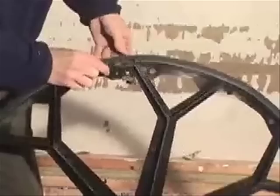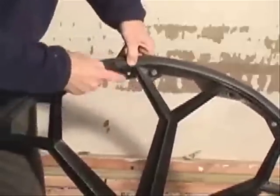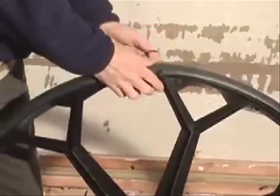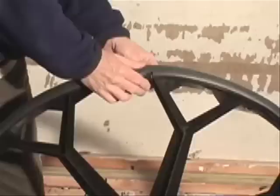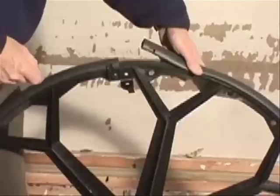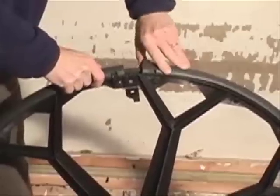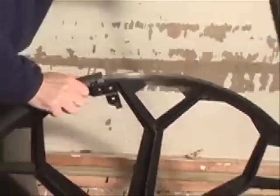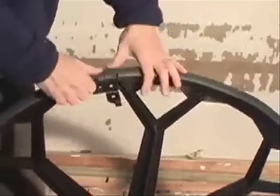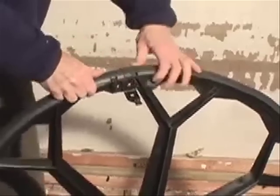Then press the ends of the tire down so they are fully seated. If you have stretched the tire too much, peel off maybe one half or less of the installed tire and stretch it less when you reinstall it, so that the ends are touching when fully installed. You can also try peeling off a bit, then secure the end and work away from the attached end pressing the tire onto the wheel until the extra tire slack is taken up. Now fold the last two plastic tabs into place to lock into the two notches in the ends of the tire and install the last two bolts and nuts with a socket, pliers, or wrench. If the tire is short, you have not stretched it enough — peel off one quarter or more of the installed tire and reinstall it, stretching it a bit more until the ends meet tightly. The tire is very stretchy and tough, so it is difficult to damage by stretching it. Just make sure that the ends meet at the wheel joint and fit tightly before swinging the tabs into place and securing with the bolt and nut.